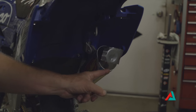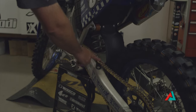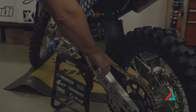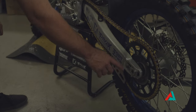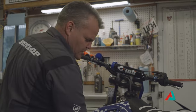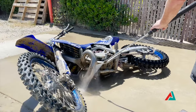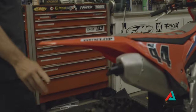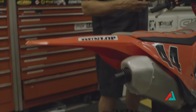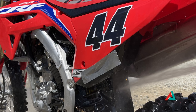There are still little seams around here, so you don't want to be blasting into these areas. Be careful of where you blast your water — you don't want to be blasting on your chain too much, just barely hit it, and you don't want to get a lot of water into the rollers. All your pivot points — just do quick passes on all your suspension pivot points. Don't be blasting away at your steering stem constantly. With our four-strokes, we have a nice FMF exhaust plug. On this Honda, we've taped off where its inlet is right here, which goes right into the air box.